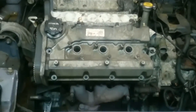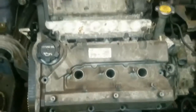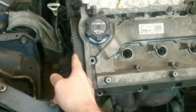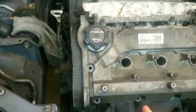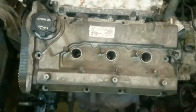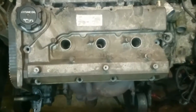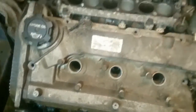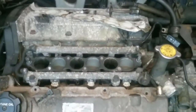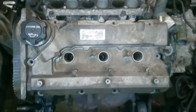Okay so Paymo back in. Today is day number two of messing around with this FTO cylinder head. Down to my left is the other engine. So what we're going to do is take this valve cover off, cut the belt on this engine — I'm not going to use this engine afterwards anyway so it's just for spares — take the whole cam girdle off, take all the intake stuff off here, all this intake pipework, fuel lines, and then we'll get the cylinder head off guys. I'll check back in a few minutes.